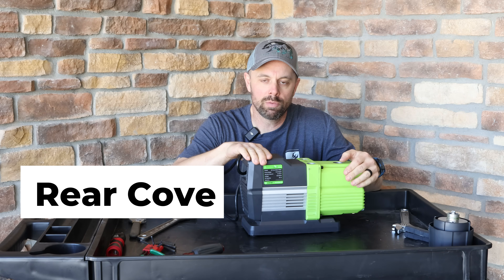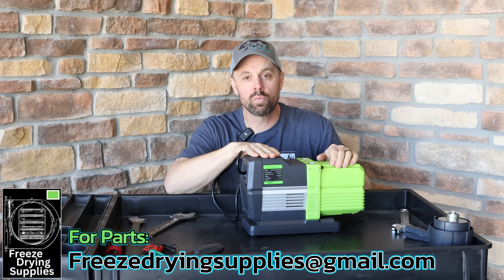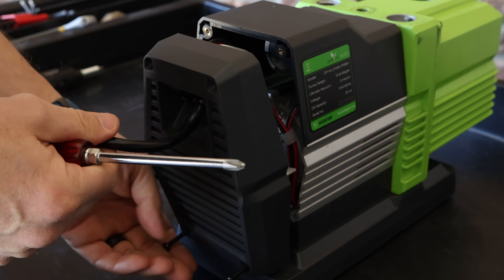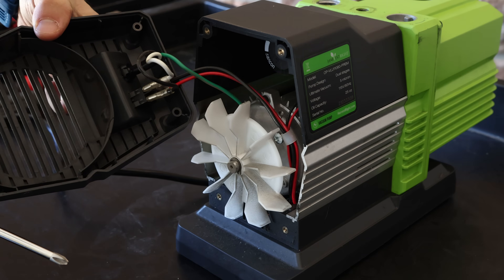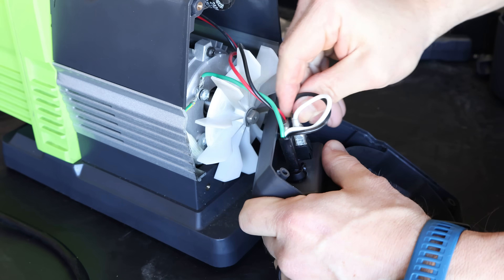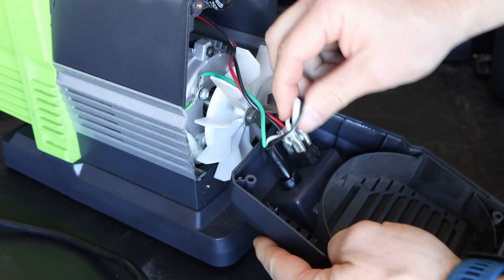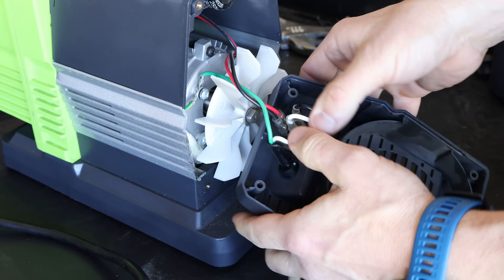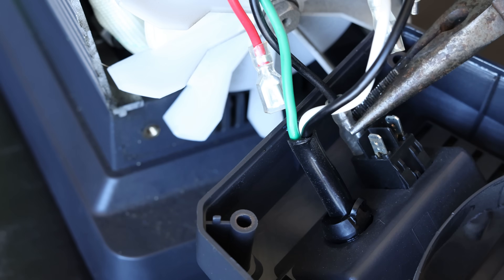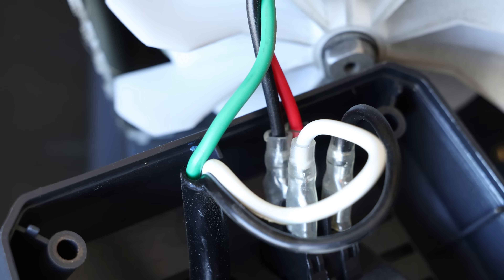Next, take the rear motor cover off before removing the front, since that's when any mess will happen. There are four Phillips screws on the back that come out easily. Pull the cover off to expose the power cord and the terminals going to the motor. Remove the wiring from the terminals — one side is connected to the on/off switch, and the other side goes to the motor. Use needle-nose pliers to pull by the metal part behind the boot, not by the wire, or you risk pulling the boots away from the wires.